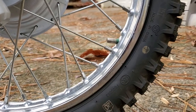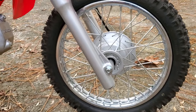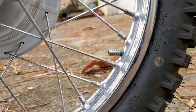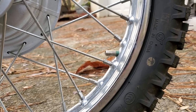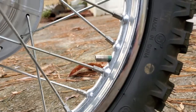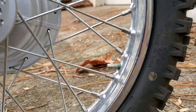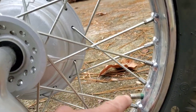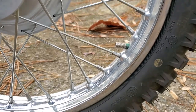If you have a little mini bike and your valve stem is leaning backwards — because these little wheels don't have rim locks like the bigger motocross bikes — that's very easy to fix. Just let all the air out of the tire, or you can take the valve core out with any method that you have.